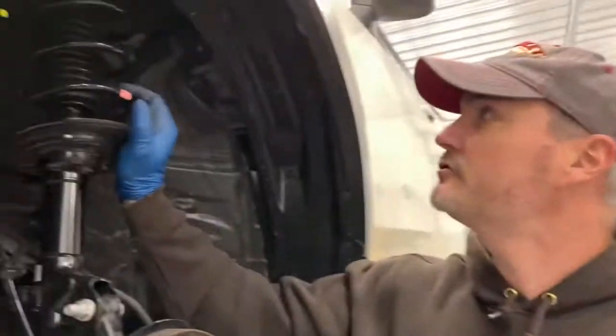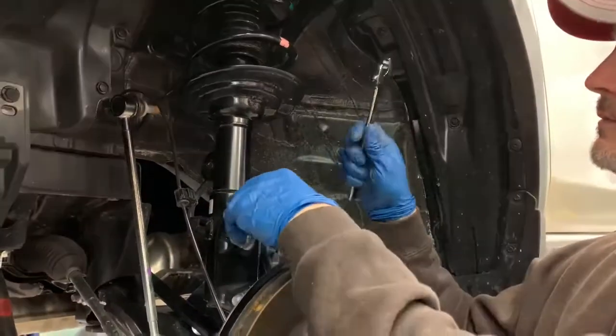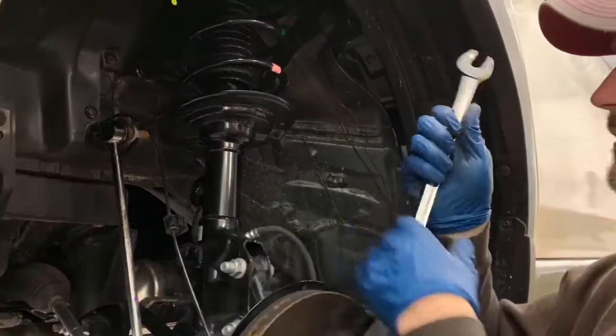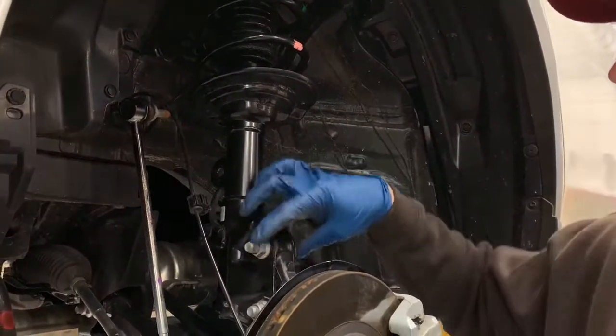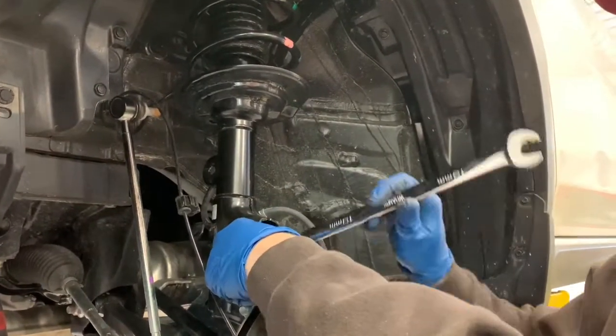Okay, so we've got the strut back in there. It takes a couple people, so get somebody to help you, and you line your 3 bolts in at the top of the strut. You put your knuckle back on here, and you put your bolts back in. Remember, your cam bolt goes in the top. Keep everything loose. The instructions tell you to max out your negative camber.